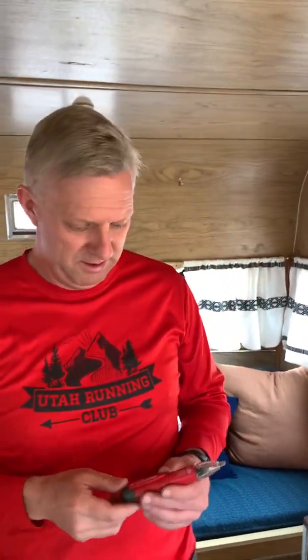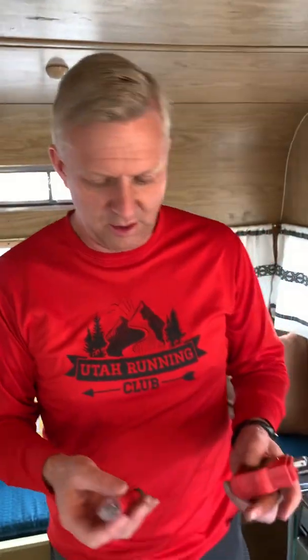This has been especially helpful for me on electric fridges, because I can never tell if they're working. When they're plugged in, you open the panel on the outside of the trailer, get into the backside of the fridge, and move the tester around the wiring to see how far your power is getting — and you can test the socket there too. I got these tools at Home Depot in a little kit for about $15, and also on Amazon. It comes as a socket tester with a few other things.